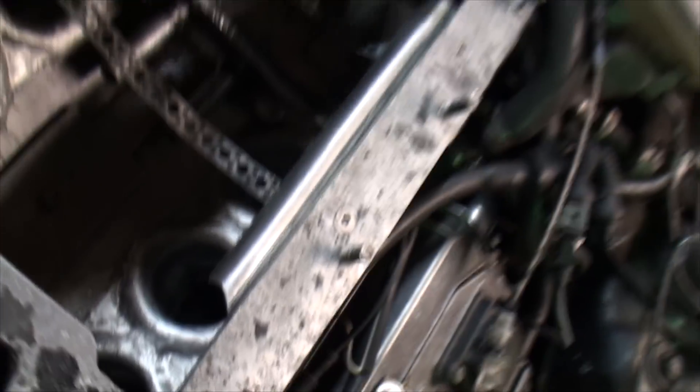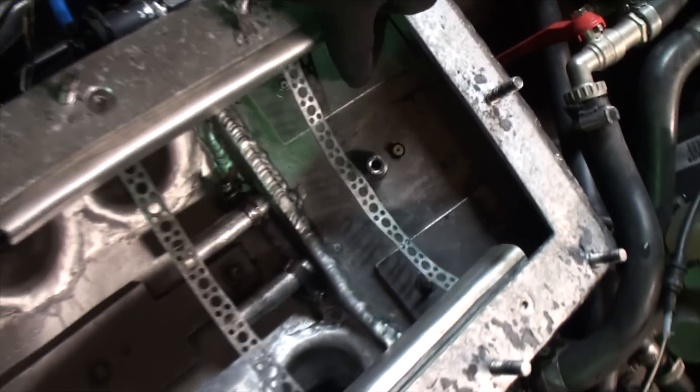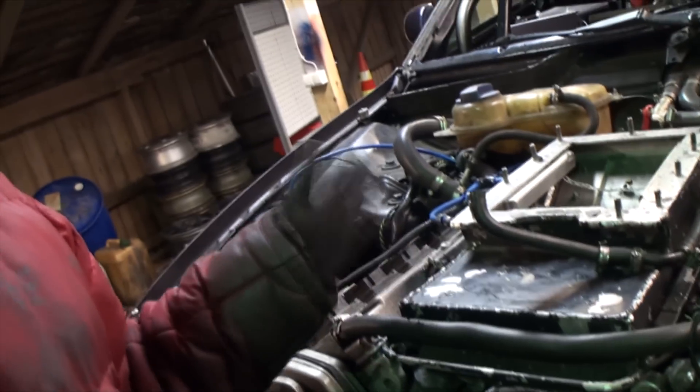I didn't originally have these reinforcements here. They are everywhere - there, and there, here and here. They are blades that are stronger, for the frame. Three millimeter aluminum is too small. I recommend that if you make your own intake manifold, you use five millimeters or at least three millimeters but make round shapes, so it will take the pressure.